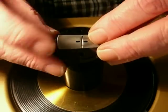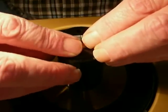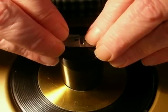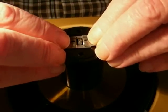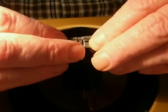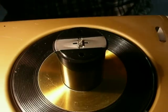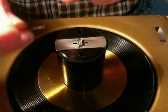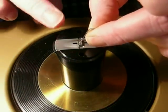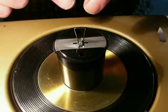It takes some practice — don't get discouraged with it. You'll have to press in on the shelves a little bit against the springs and keep your fingers at all times close by so they don't escape. Even having done hundreds of these, it's still difficult. Once it's all laying down nicely, take the top clip and very gently — because you can break this — separate it so that it grabs into the slot on each one of the metal separators. It's going to stick up in the air like that.